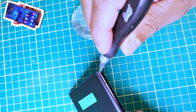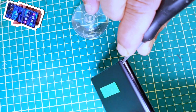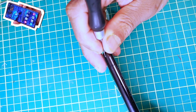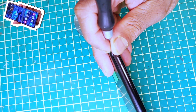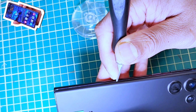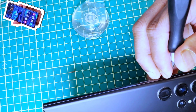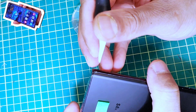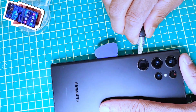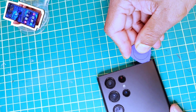After providing some heat, I was able to insert my craft knife inside a little bit and make the first opening. Now we'll provide more heat and open the remaining back panel. We have to carefully score along the glue — you don't have to insert the knife too much. You have to take extra precaution when you remove this back panel because the panel is a bit delicate and you can break it. Replacing it would be an extra cost, so be careful.